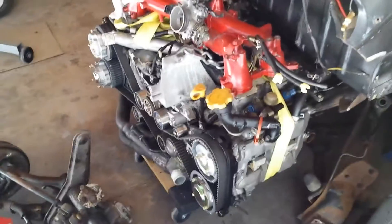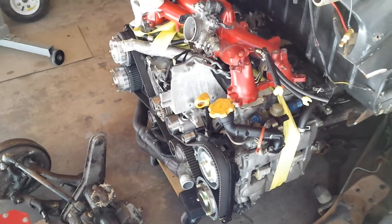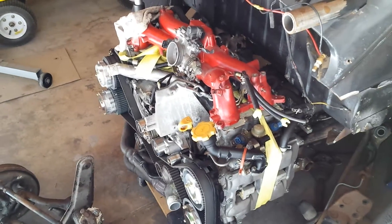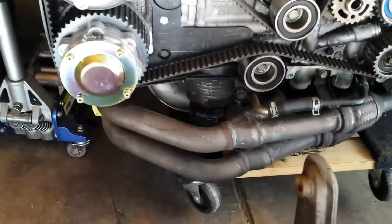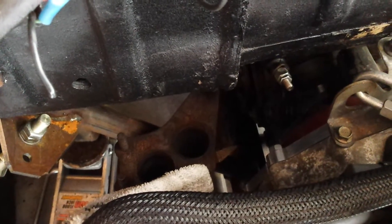But back to the car. I'm going to be running this engine right here. This is an EJ20 — it's actually an EJ20Y Japanese spec Subaru engine. It's got the 2002 Subaru WRX intake manifold on it, and it actually fits fine except for a couple of holes I've got to ream out, but no big deal. This is a twin scroll turboed engine. You can see the manifold down here. Twin scroll helps with spooling — if you're interested in that, check online for an explanation.